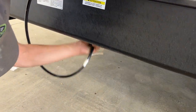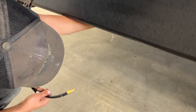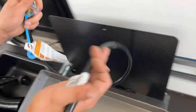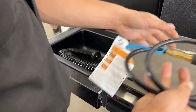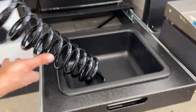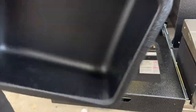The one thing to go over is the hose — close off that flow of propane, undo your hose, and put that dust cap back into place. Bring it back up top, undo it at the stove. I just like attaching it to itself to ensure nothing gets inside. Then store it back away. For the sink, it's just a single basin — there's no drain for it, so you're just pulling it out and dumping it.